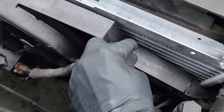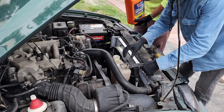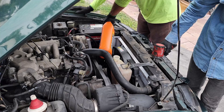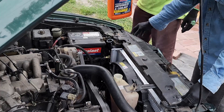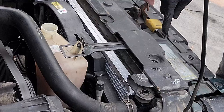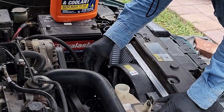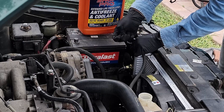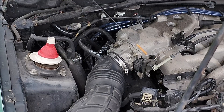As you can see, I was using zip ties to hold that cable because I was not able to get the original clips that hold this cable, but this will do. Place the water container back and start filling up the radiator. Now it's just a process of putting everything back — put the plastic cover back in place, and don't forget that little hose that goes from the radiator to the container. I didn't have an original clamp so I was using a zip tie to secure it.